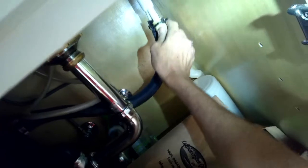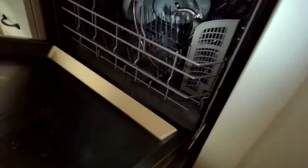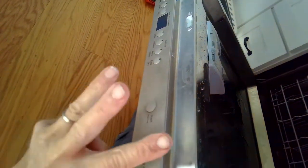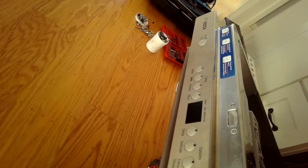I'm going to push it down underneath — that's just so I can remove that dishwasher drain tube a little bit easier. The white tube is the one coming from the dishwasher; the black tube is going over to the garbage disposer. We can see that it's full of water and it's not draining.